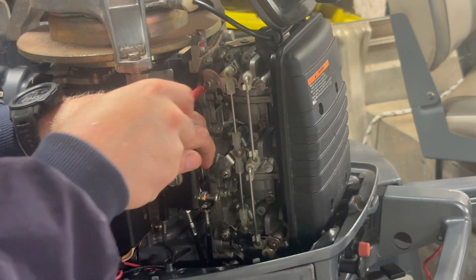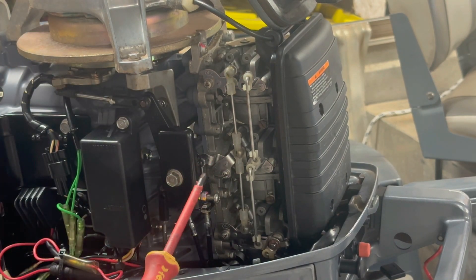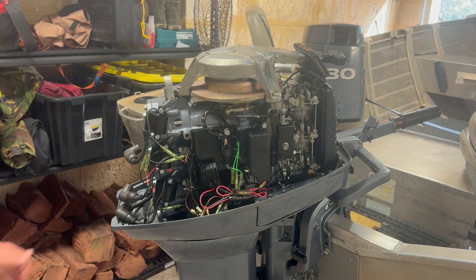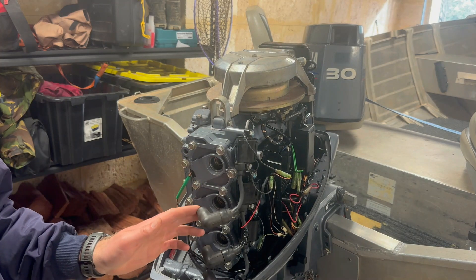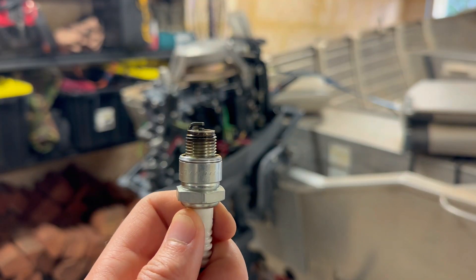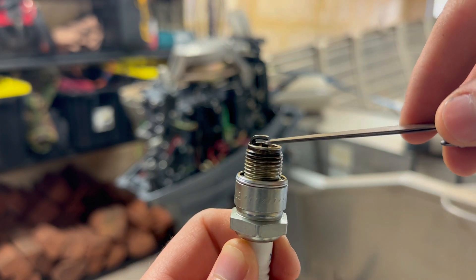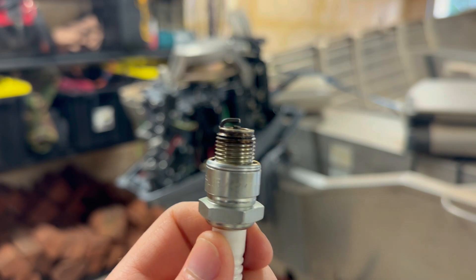Just nip those back up. So now with the center carburetor in the closed position, we now have the closed position of the two other carburetors. Next we're setting the timing plate, so we need to remove all three spark plugs, which is a good opportunity to check the spark plug gap. Using feeler gauges — that's perfect — one millimeter for this engine.